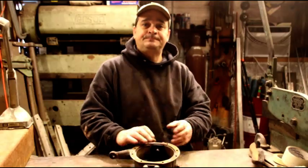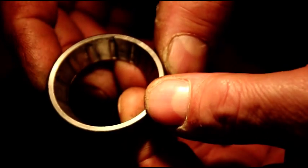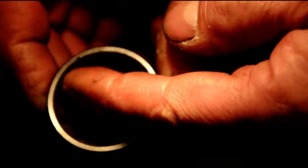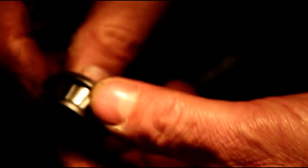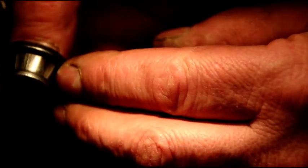Here is a close-up of a kingpin bearing cup, and I hope you can see how the rollers have beaten into that cup. Every time you get a roller out of the cup, it feels like a notch. Here is the actual bearing that came apart — a bearing is supposed to look like that, but this one came apart. I hope you can see the notches in here as well; the whole thing is beat up. Here's the other side cup — again, fully notched.